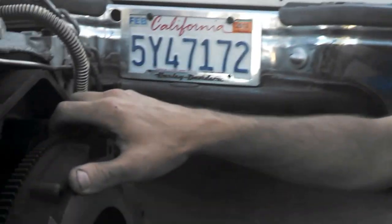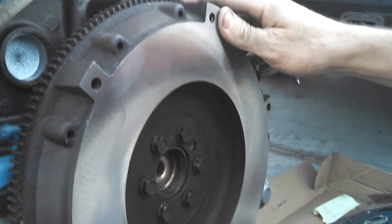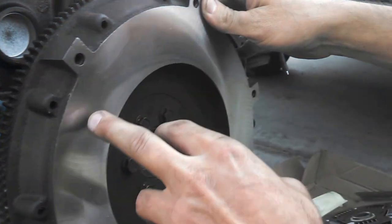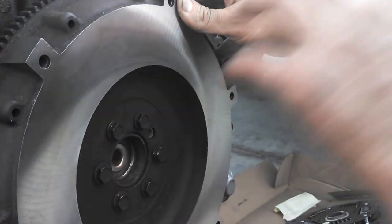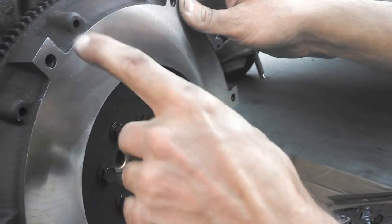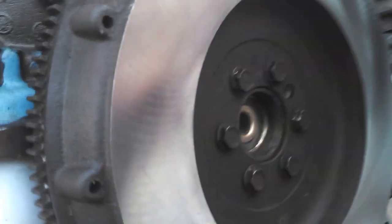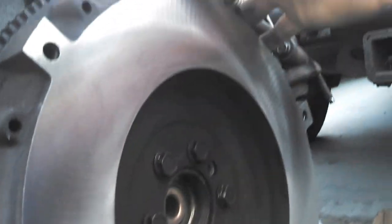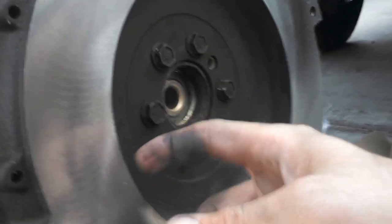Let's start with the flywheel. I have the flywheel machined first because this one had burn spots all over it. With the burn spots, you're going to get spots and dots on the flywheel where it just got really hot. The surface came out stellar — a really nice flat surface. That's where the stone came through, just taking off any excess material that was burnt. I think they take off several thousandths, maybe ten or twenty thousandths on it.